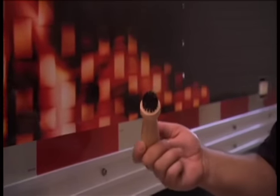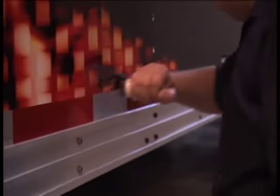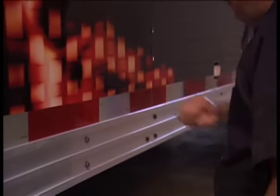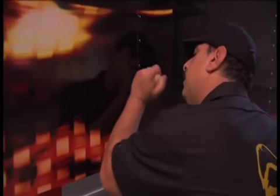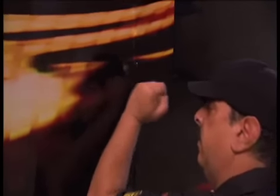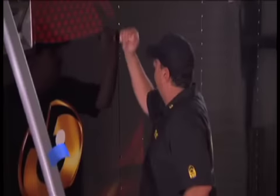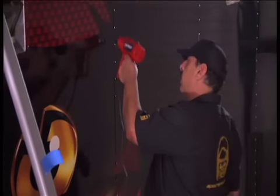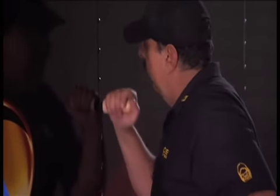There's always a need for a rivet brush, so have one of these handy at all times. You'll use this on rivets and other areas that the squeegee won't work. After the pinwheel has made the penetrations, the installer will apply a small burst of heat, making the area more pliable. Some manufacturers' rule on temperature is 200 degrees Fahrenheit — do not exceed that temperature. If you are unsure, please see the manufacturer's recommendations. The installer works the brush with medium pressure and rotates the brush in a circular motion, pushing all the air from behind the rivet.